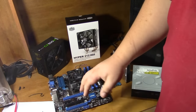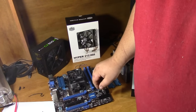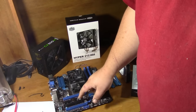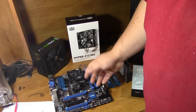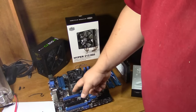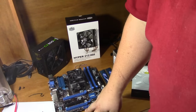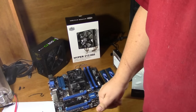I do some light gaming and obviously video rendering. Once you decide on the CPU and motherboard, your motherboard needs to also have the features you want. If you want to overclock, make sure your motherboard supports that, and that it has all the SATA 6 ports you need, all the PCI Express slots you want, whether you want USB 3.0 or not — that sort of thing.